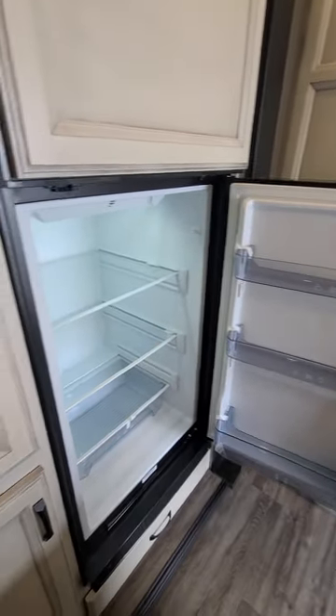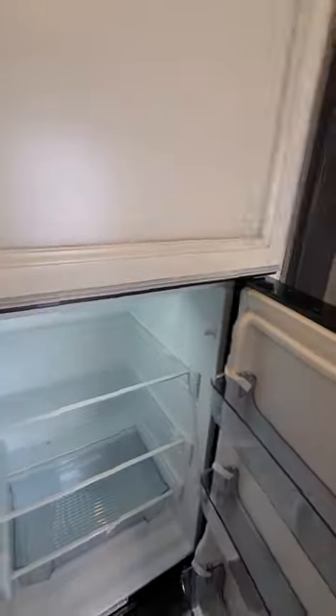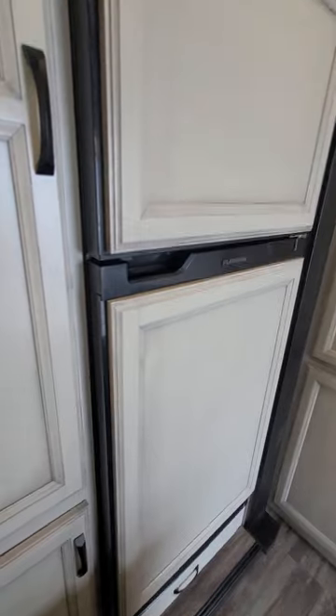That's going to be right next to our 12-volt refrigerator by Furion. When those slide outs are closed it is going to be next to impossible to get inside of this fridge, so plan ahead accordingly. You are going to have the controls right here to be able to adjust the temperature. There is an off-grid mode, and then there's an all-the-way-up setting for when you're at the campground. If you're boondocking or driving to the next location you could keep it in the off-grid setting. For the freezer space you're going to push up on this to open it and you'll have that freezer space in there. The freezer is going to cool down quicker than the fridge, and we usually say we want to turn that refrigerator on at least a minimum of 12 hours ahead of time — they usually suggest 24 hours. If traveling, you could get away with throwing some pre-frozen items in the freezer or fridge, utilizing this component like a cooler.